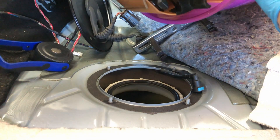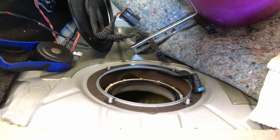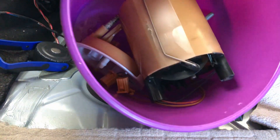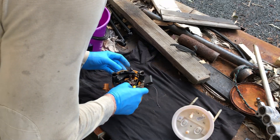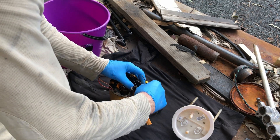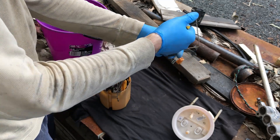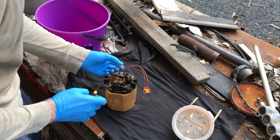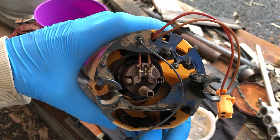I'll try and tip some of the fuel back in there. All right, that's out - that wasn't too bad. Let's go and get this on a bench. Pop that off without damaging it. Let's put this little sender aside, undo the little wiring harness and slide that out. We'll probably want to keep this plug to use on the new fuel pump. If you can see in there, there's a bit of gunk and stuff - I'll clean that all up.